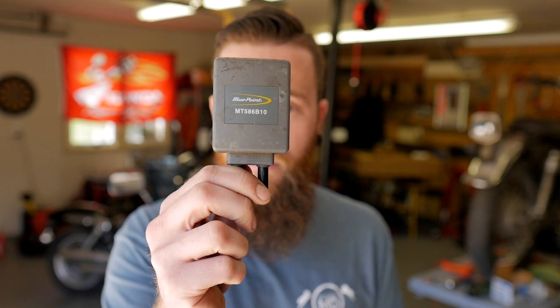You buy brand new coils, brand new ECU, you've done all this stuff and still can't find the problem. In this video I want to take the guesswork out of diagnosing those parts when it comes to a system that requires a special tool — in particular, electronic ignition on newer bikes, 90s, 2000s and up. They use ECUs, ICMs, and with a special tool like a peak voltage adapter that plugs straight into your multimeter, we can diagnose ignition coils, pulse generators, and exciter coils.